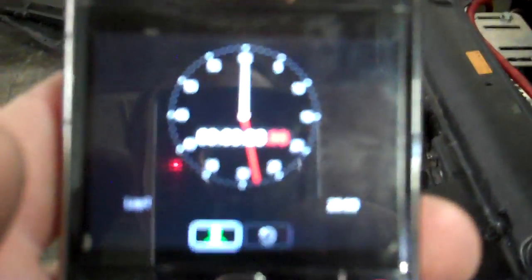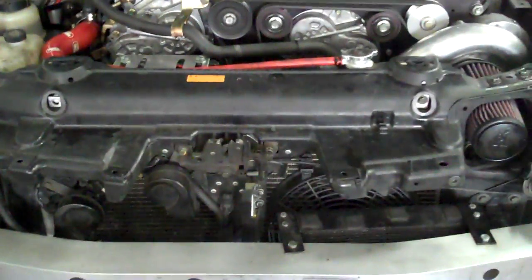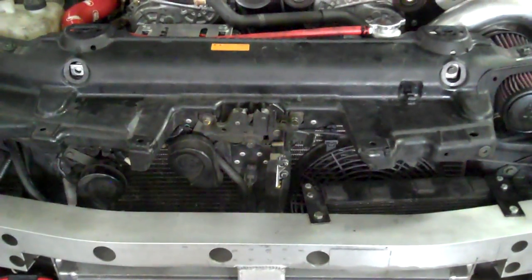As you can see, it took 28 seconds to cool this engine down from 210 to 197. Having three fans — even though they're little fans, the little Mishimoto ones, little tiny ones — gains another 10 seconds of cooling. In hot traffic on a hot day running the car, this car with three fans severely cools itself much quicker, including the fact that it has an AMS radiator. So if you're looking at cooling your car down, be savvy that you might need more than just one fan to do the job.